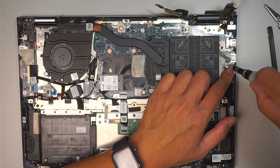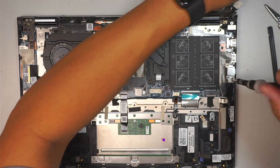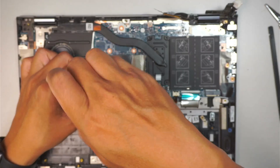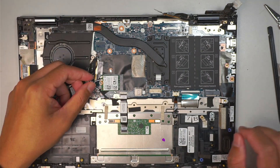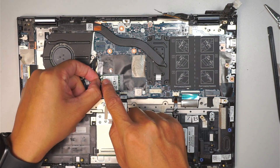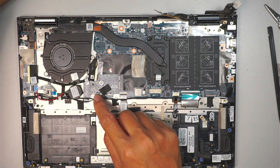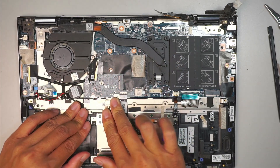That is the USB-C connector — there are two screws holding down the bracket; you need to remove those two screws and then remove the bracket as well. This is your Wi-Fi. Remove that one screw, remove the bracket. The white cable is at the bottom, the black cable is on the top. The connector just sits on top of each other — you just have to lift it up and then slide that Wi-Fi cable to your left to remove it, and just expose that cable downwards.